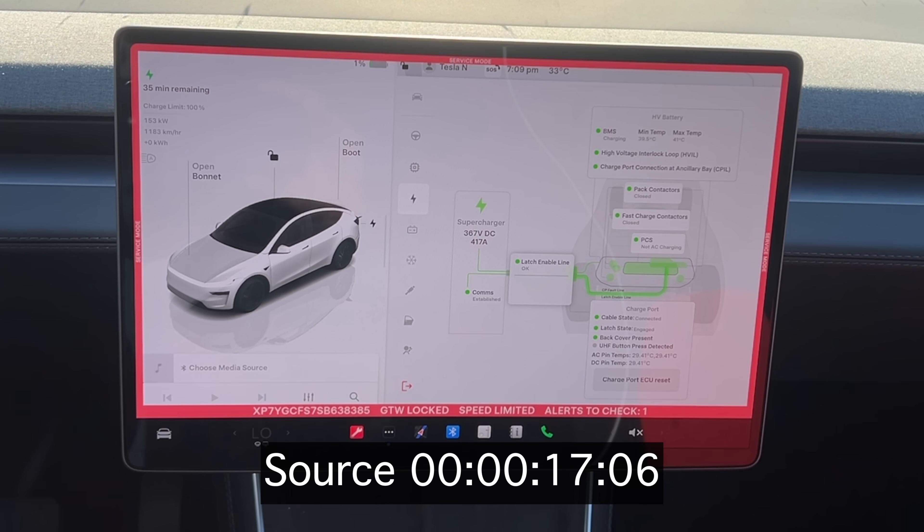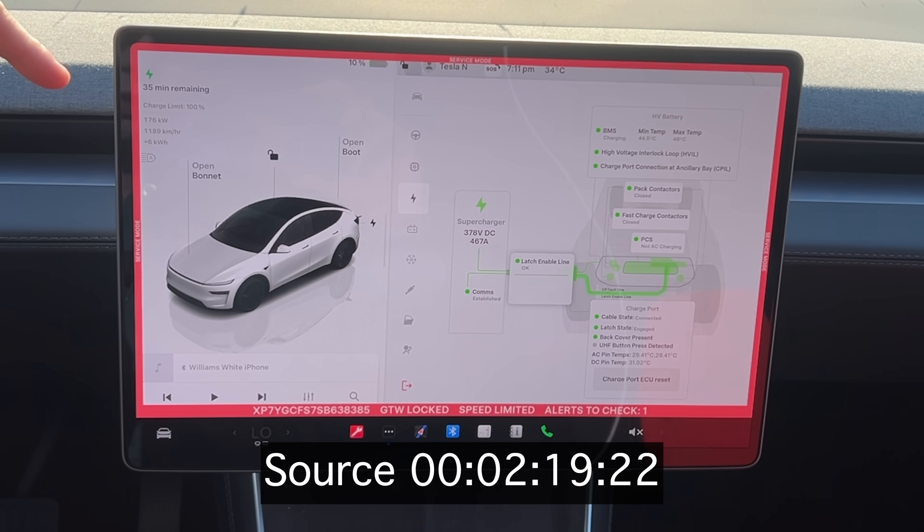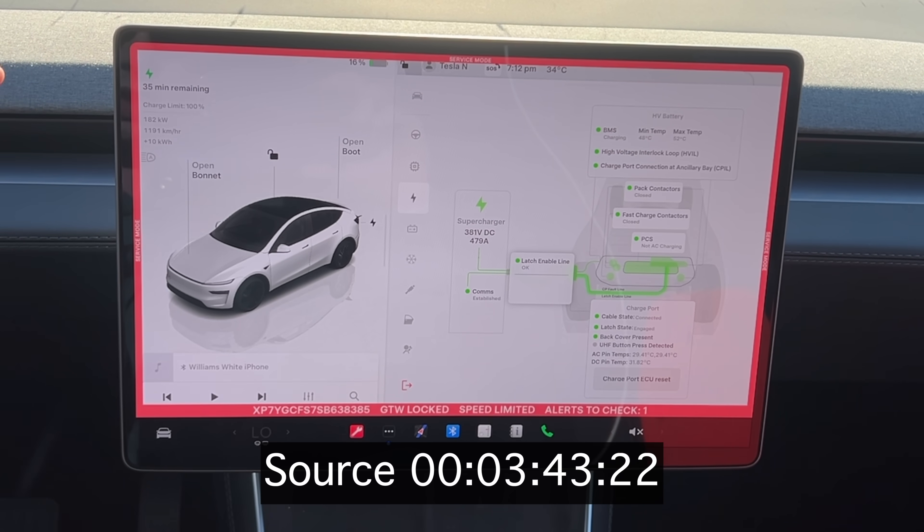We see 132, 153, 175 kilowatts — very nice. After speeding up to 10%, we see 175 kilowatts flat to around 10%, which is great. We even get a little more than 175 kilowatts. After 10% we keep ramping up and actually reach 180 kilowatts — a better peak than both the BYD Blade Battery and the older CATL battery. I'll also be doing a 10 to 80% charge to directly compare it against the old CATL battery.